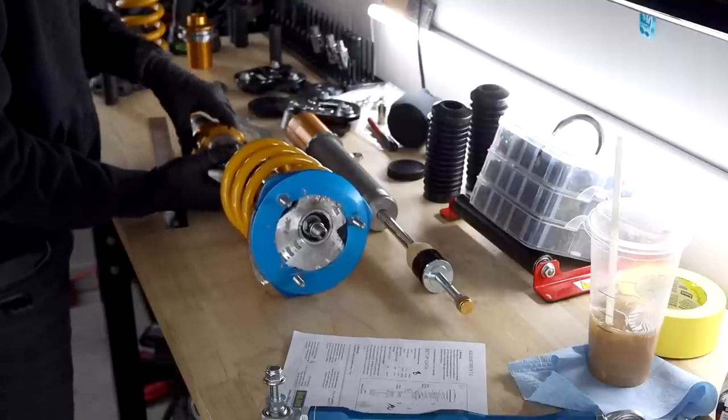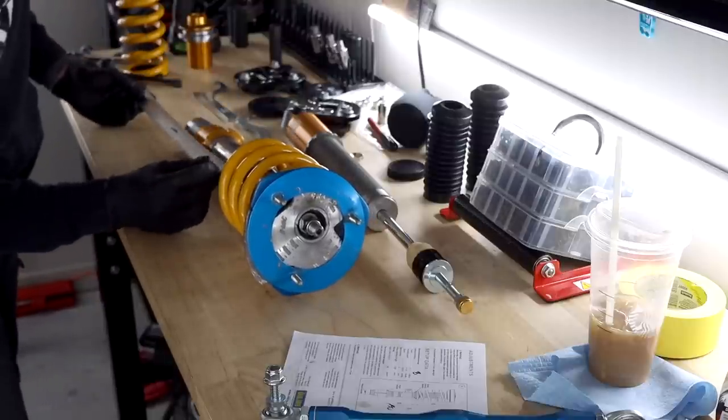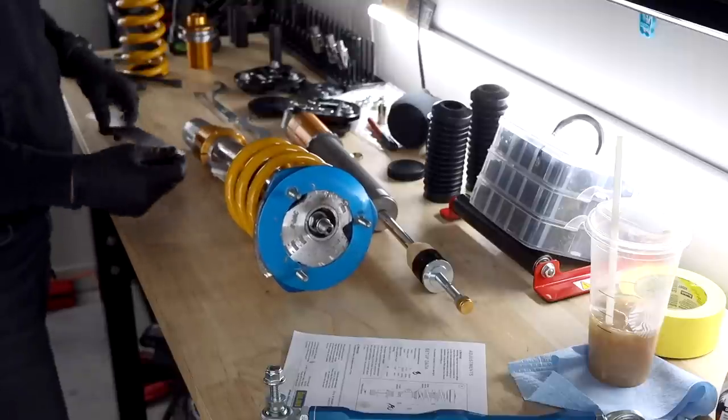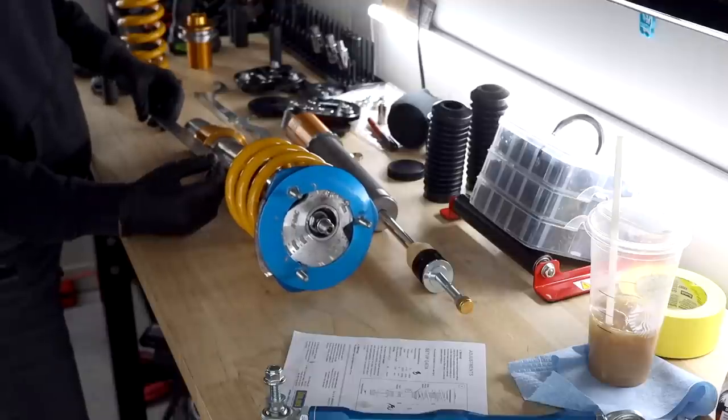And you have to be cautious of this because this spanner piece down here on the lower end of the shock spins very freely when you're installing it. Be sure not to move this around. Basically the way it works is that pass-through nut and bolt will clamp it down and hold it into place. So we are exactly at 140 millimeters, and that'll be our setup.